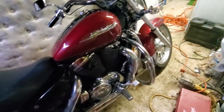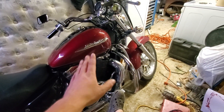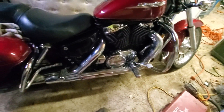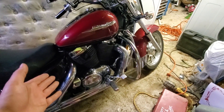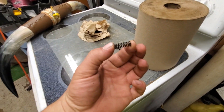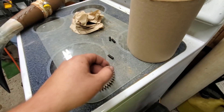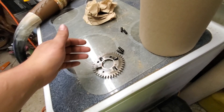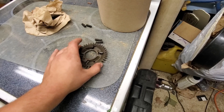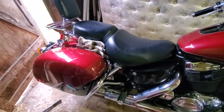That's still got that pretty bad valve tapping up top, but that's not really harmful and I can do that some other time. The big thing was getting that sound away that sounded like a rod knock, and turns out this little sprocket here was the culprit. I'll probably keep it around on the shelf and maybe get some springs in time, but really I don't see any reason to have this in there. Honda put it in there because people don't like hearing unusual sounds from their motors, even if the motor runs just fine — as I can attest to in my case.